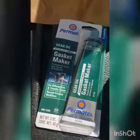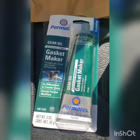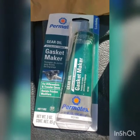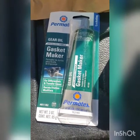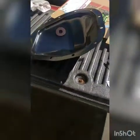I picked up a thing of RTV - and it was actually differential RTV. This I haven't seen before, but this is gasket maker specifically for differentials and transfer cases. It resists friction modifiers, because the friction modifiers can apparently break down regular gasket material. It was like $13, but I figured screw it. Actual gasket maker for differentials - I'll let you guys know how it is when I get it together.